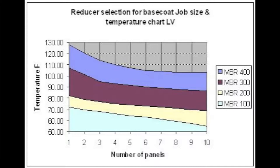Overall, as a group, you've got to pick them a little bit more carefully. You can see that they have a wider range for some of them, but they are exempt, so as a whole they're going to be a little bit faster. You have to watch the gun distance and everything as you do with most low VOC products. But as a general guideline, the same thing applies. You want the base coat to actually flash out so that it'll have an opportunity to orient the metallics properly, to achieve the right color, and to level out and adhere well and provide a perfect surface for the clear coat to go on.